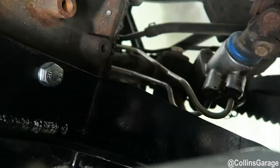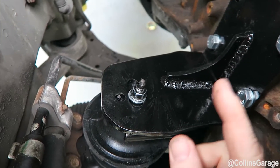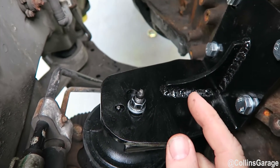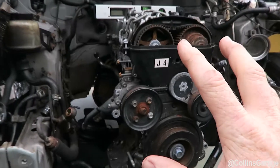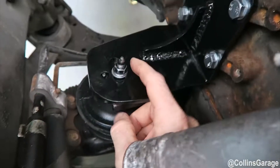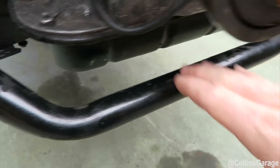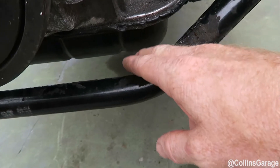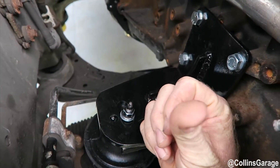We also made it slotted — let's go to the other side so you can see better. We slotted it back and forth. We shoved the engine and trans combo as far back as possible to show you what it's capable of to get the radiator and stuff into the stock system. But essentially we gave you a slot to bring it forward. We have maybe another three-quarter to a full inch between the gap of the front sump oil pan and the stock sway bar, so about three-quarter of an inch of slot adjustability to go forward if you want.